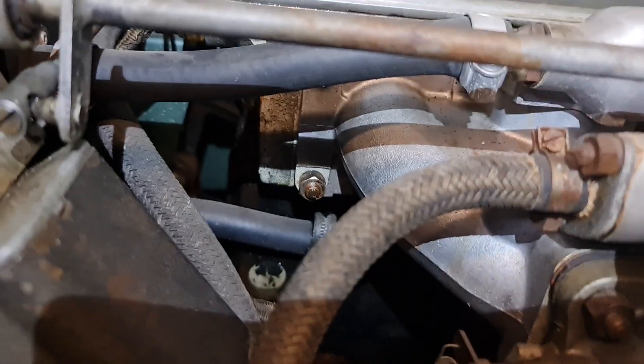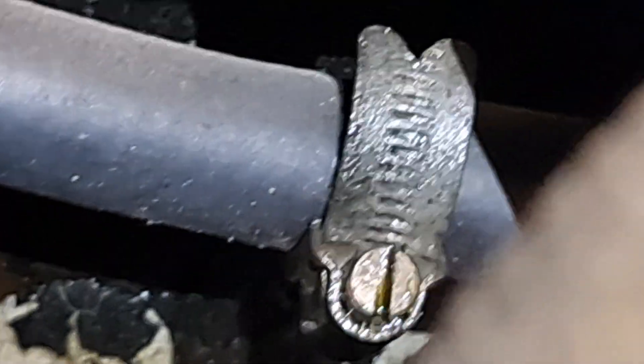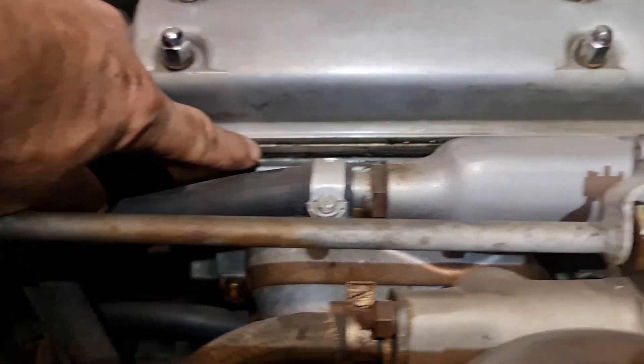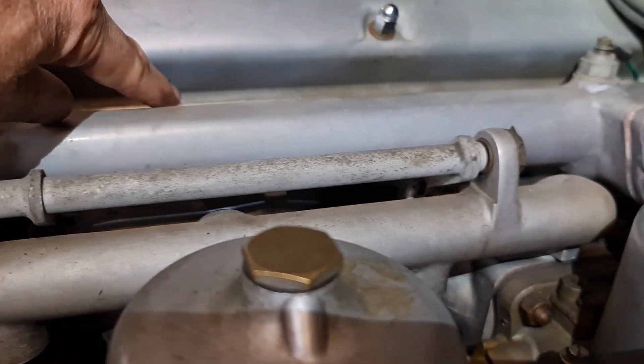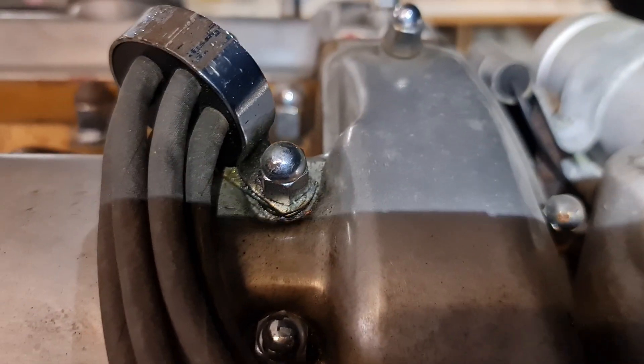The reason why I started to change the oil is I had the engine all oiled up and I found that the cam covers were not sealed good enough. You can see oil between there, it's dropping down and pouring all the way down the engine. I always had some oil drops on the floor — I don't know if I can avoid that at all — but this is what I wanted to eliminate, so I'm going to replace it.